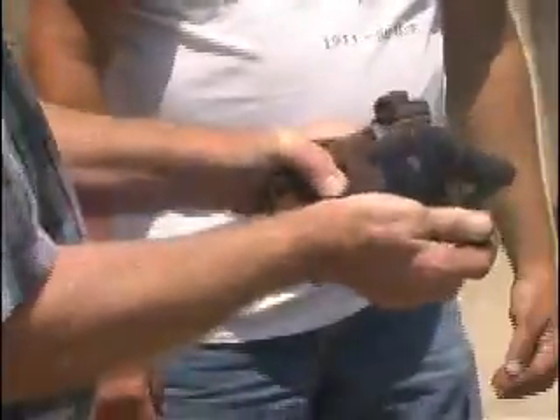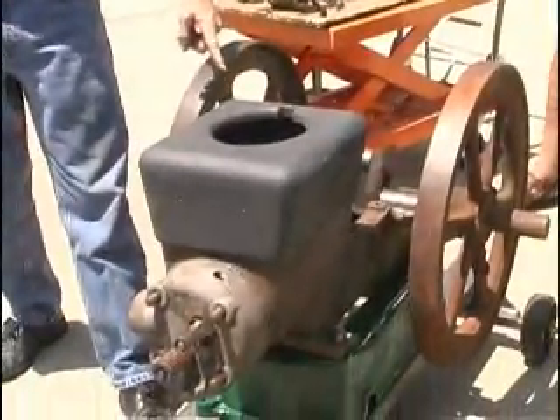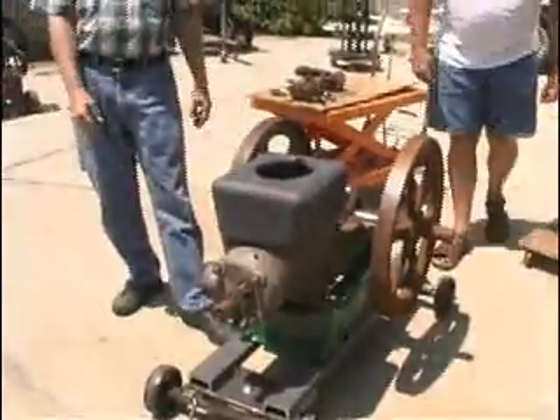The little lever gets flipped by the rotating machinery of the engine at the right time. There's a spark plug wire that comes out here, just mounts in here, and the spark plug wire comes around to the front to the spark plug. For oiling, there's a pipe that fits down in here to drip oil down onto the cylinder, then an oil container goes on top. That's a typical assembly procedure for an engine.